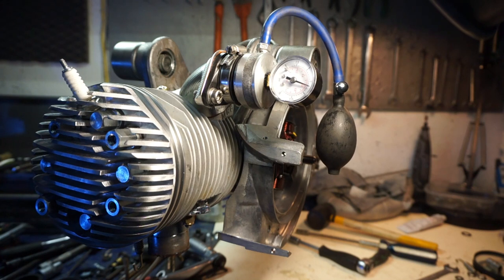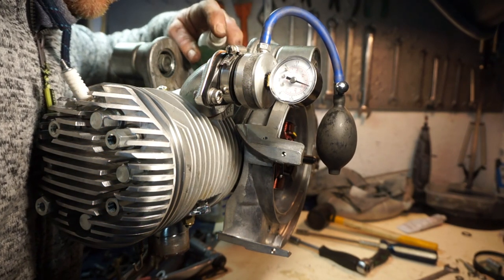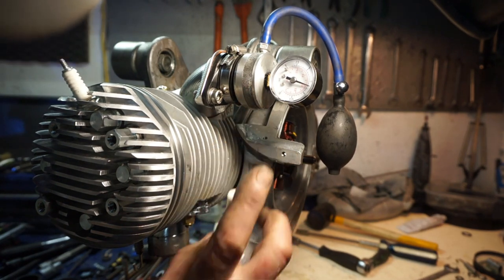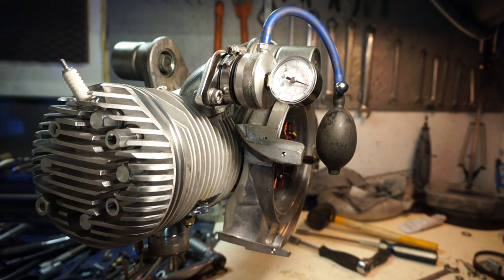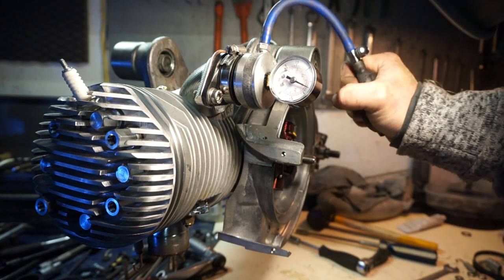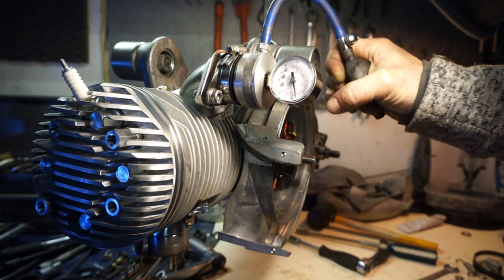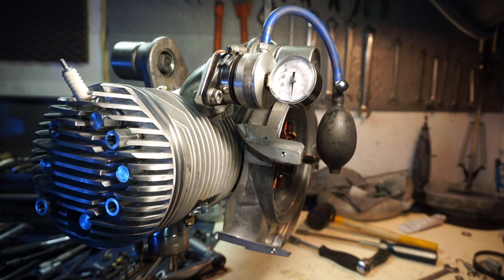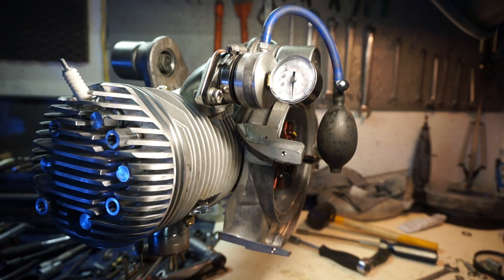Let's spray some spray around it, just to double check. Nothing coming out of the casings. Yes. Ah, yes. A bit more pressure in it. That'll do nicely. Yep, that's a success. Why that was leaking, maybe the gasket broke as I fitted the mag housing in or something. Yep, broken gasket for some unknown reason.